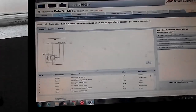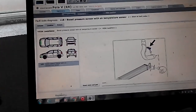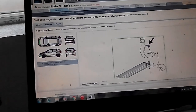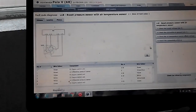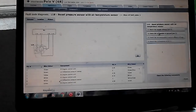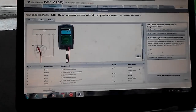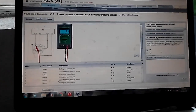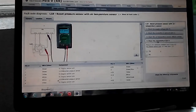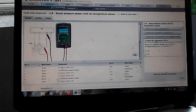Now what we are going to do is go on Vivid Workshop Data. I have entered the fault code. This is the sensor that goes from the intercooler into the inlet manifold, and the sensor looks like this. Now we have the diagnostic procedure: we have to check the supply, then we can check the connection to ground, check the supply voltage for the air sensor, and also check the connectivity of pin 4. That's why I'm going to raise the vehicle and start searching for the problem.